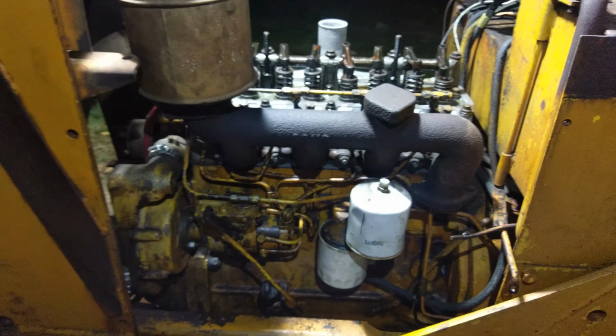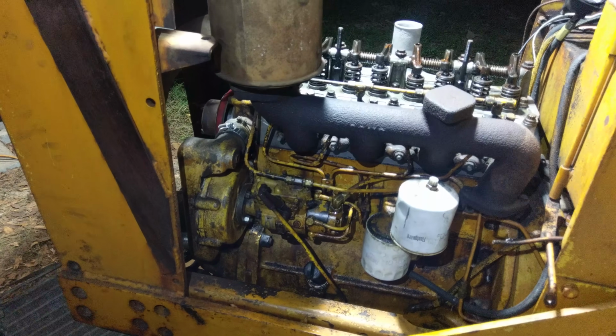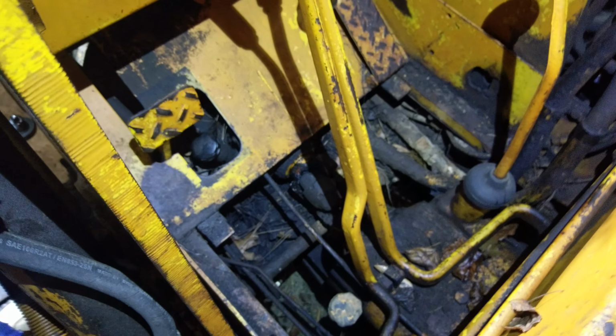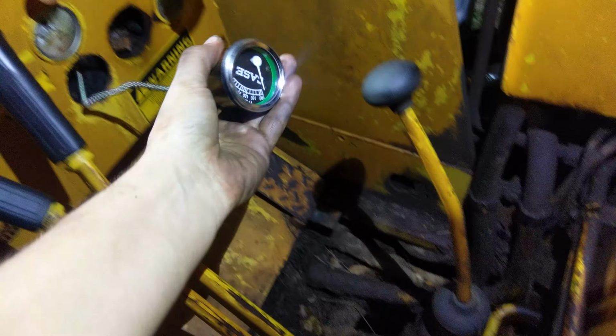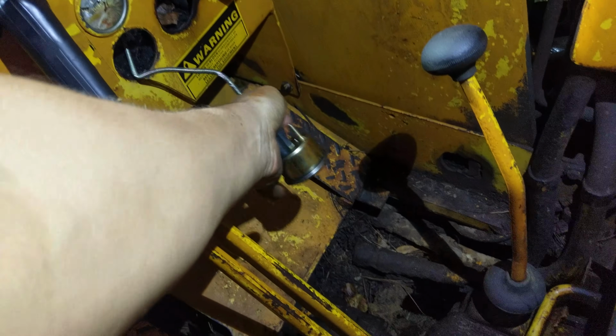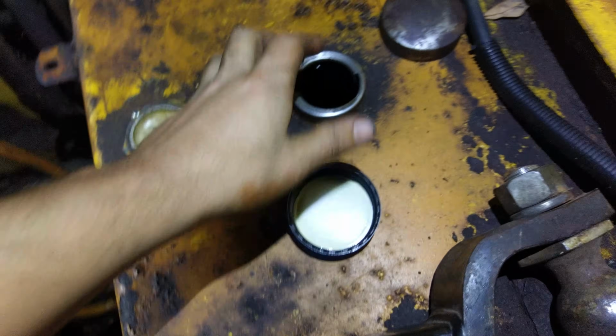I think I might fix that. I'm going to put a lift pump on this because I don't like that. If I knew anything about P7100s or whatever denominator that 24 valve pump is, that's what kills these is suction. Pump cavitates, tears it apart, and that's that. Hey, I wonder if this gauge works. I hope it doesn't read over 100. This thing shouldn't be very hot. No. It's not even reading anything. But yeah, I got some red number 2 in there.